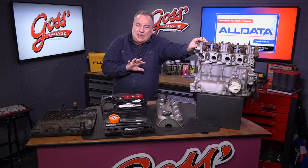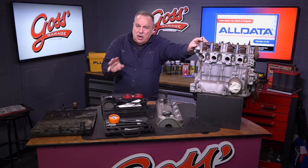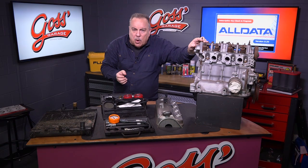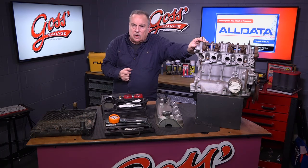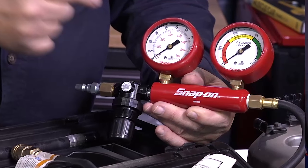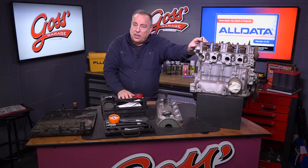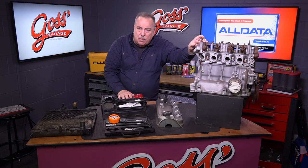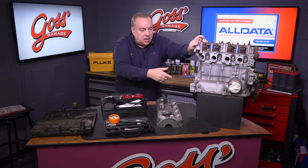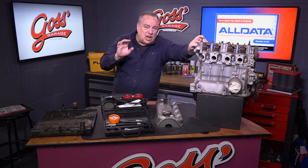This is what separates the guesswork from the testing. Lots of times you may go into a shop and they tell you, you've got some kind of a problem inside your engine — we don't know what it is, but we've got to tear it down to see. You can get a much better idea by using the cylinder leak down test. That is a whole lot cheaper than tearing the engine apart, which starts out in the hundreds and can go up into a couple thousand dollars on some engines. So before you ever make the decision, you've got a good idea: is it in the bottom of the engine, is it in the head gasket, or is it in the top of the engine? A cheap, inexpensive test gives a lot of great information.